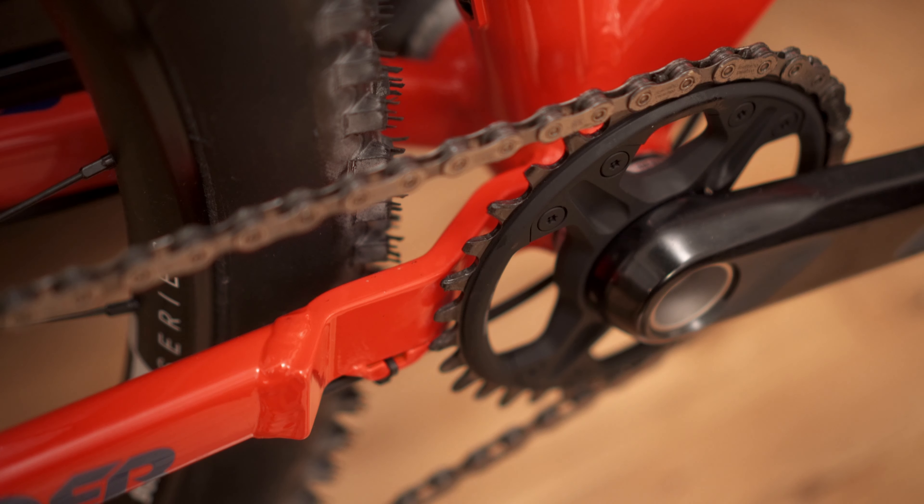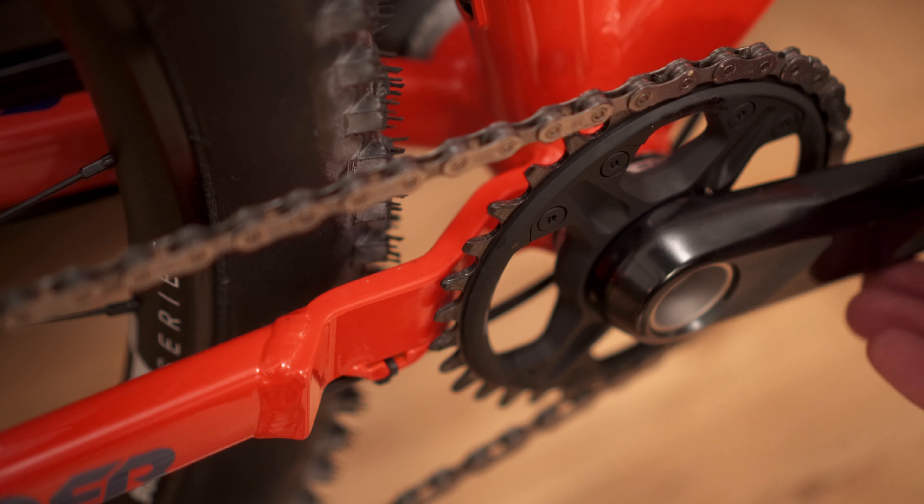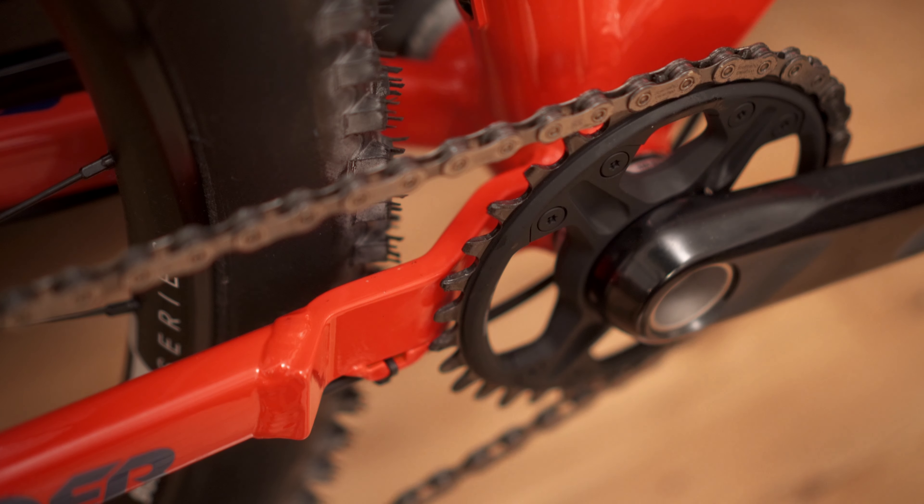Looking a little more closely at this chainset, there's one feature of the frame I'm not super enthusiastic about — this little chainstay bridge here. You can see the chain ring gets really worryingly close to it. Going by the shape of it, it looks like it was designed for a two-by drivetrain with a smaller inner ring and bigger outer ring, hence the stepping on it. So I'm a wee bit worried — if I wanted to upgrade to something like a 34-tooth chain ring, whether that would get a little bit close, because I'm not super keen about how close it already gets there.